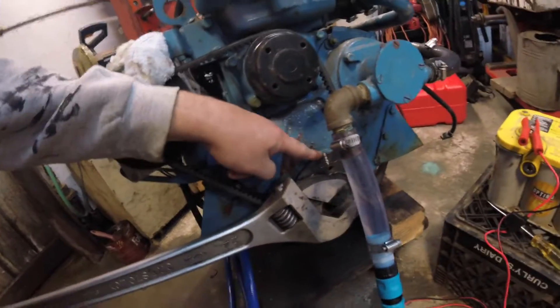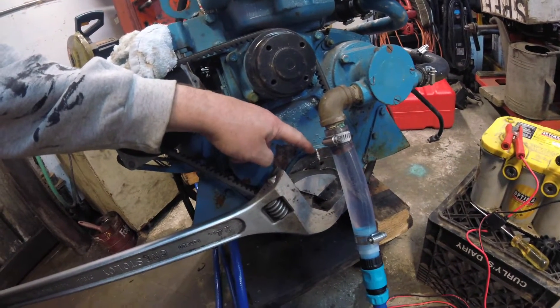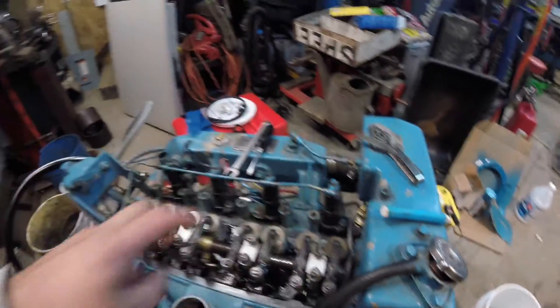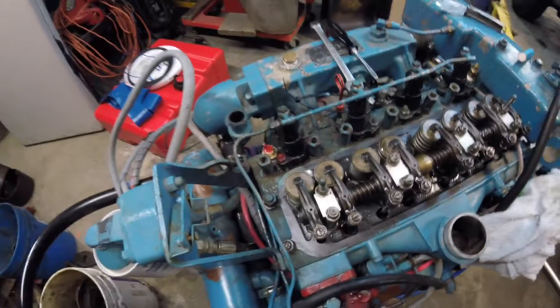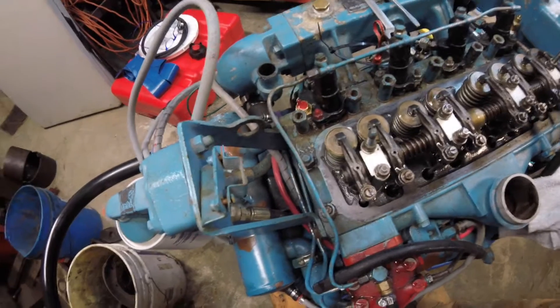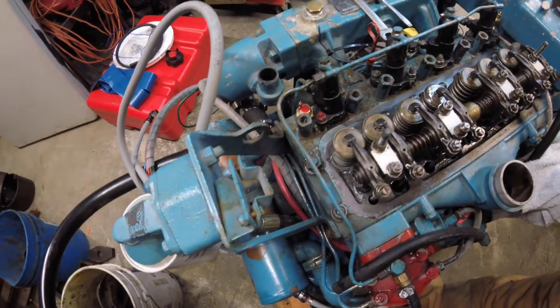Once I find that position I'm just marking a mark to help me. This doesn't mean it's top dead center or anything — this just means that this is where my mark is. So when you are in this overlap position with cylinder number one, you come down to cylinder number four and this is where you check the valve adjustment, or what the lash is — lash meaning slop or free space.